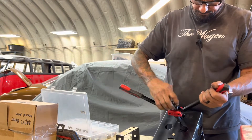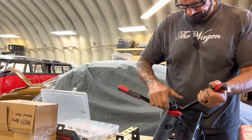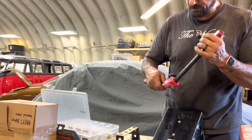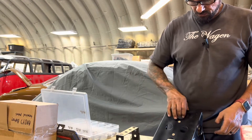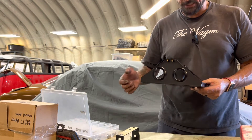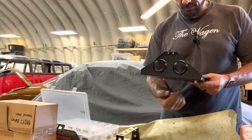This is ready for install now. Obviously inside the vehicle you'd put this inside there, mark your holes in your tray when you get it positioned where you want it, punch them through from the top, and your hardware's going to come through from the bottom.